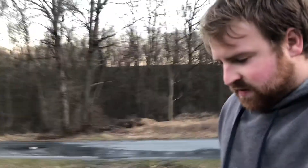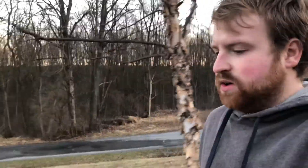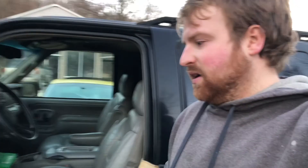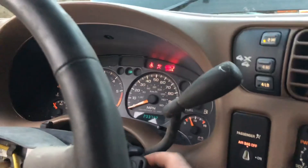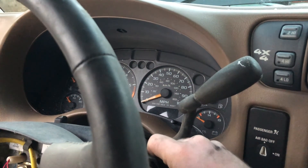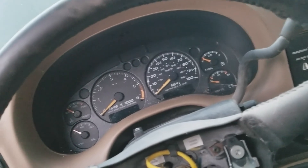I've not had good luck so far trying to get it to start. I have my little jump pack, which is great, but I'm not sure it's giving good enough juice because I've jumped a couple cars with it and haven't recharged it. So I'm going to get the old rescue plow truck again and hook up the jumper cables and see if we can troubleshoot a little bit. See that security light flashing? I think that might be part of our problem.